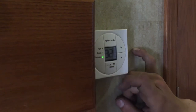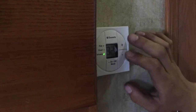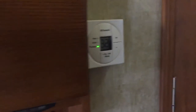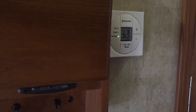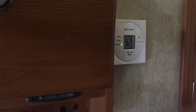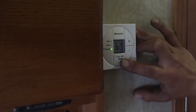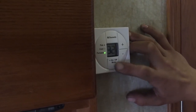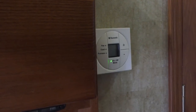After cooling, hit mode again and it'll come into furnace — it'll turn off the air conditioner and turn on the furnace. Temperature selection again with the arrows. The furnace moves its air through a bunch of little ports on the walls or the floor registers. With it being a used unit you shouldn't have to deal with the new furnace smell too much. After furnace, hit mode again and it'll come back to on/off and cycle back around.